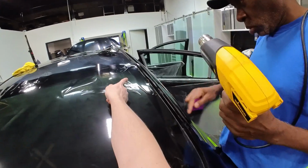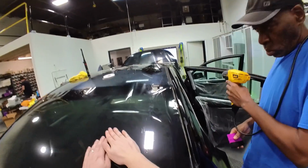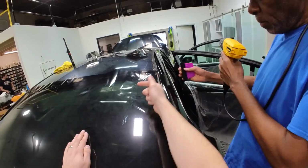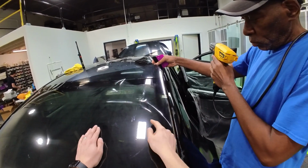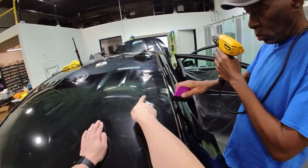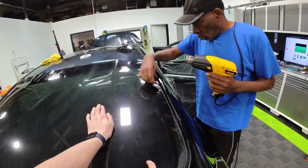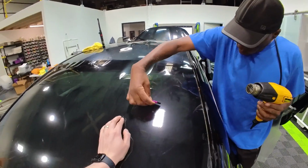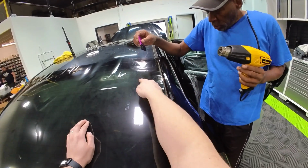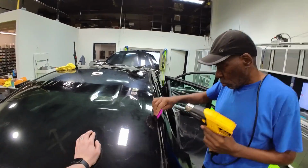All right. So this line, we made sure this was laying flat, but this swoop wants to come out here in this direction. So I would just loosen it up a little bit, and then to make sure that it's not going to stick, that's good enough right there, just a little bit. And then take this and start scooting that swoop that way, and then see what happens. Perfect. Yep, that's far enough because now these are lines. Okay. So these are points coming down. So lock that down flat again, and now you're good to continue shrinking.